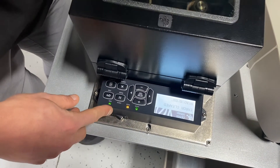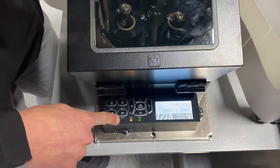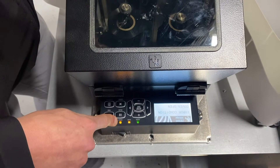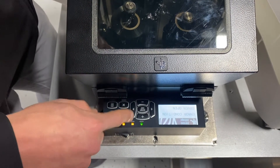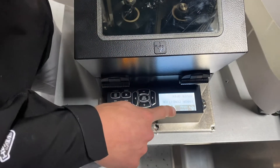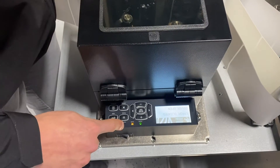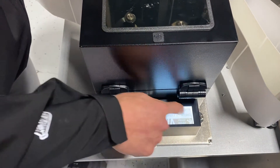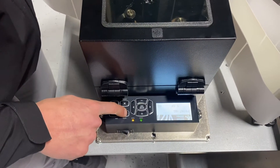If I slightly open this cover, you're going to see a status light come on. Anytime I have a present error, that status light is either going to come on solid or it's going to start blinking — that means I've got something I need to address. For this instance it's an error condition cover open, so I would close the cover. Status light goes away and it's telling me I've cleared everything, and now I have to unpause it because I cannot have this printer paused.